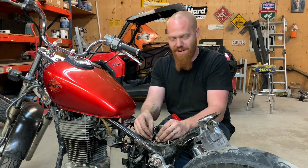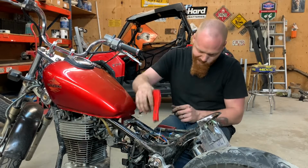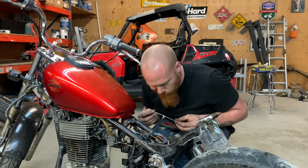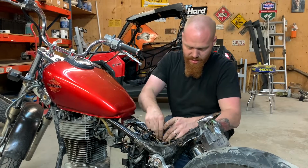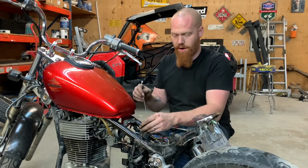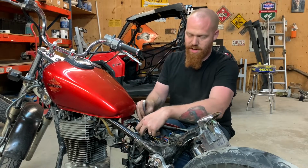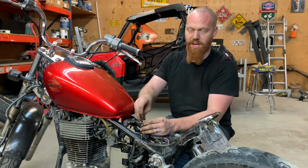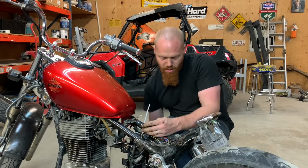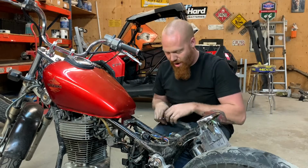And something else that I never actually mentioned in the video, which is funny that I didn't. The day we got into St. John's, we got to the campground and we were hungry and it was like 10 o'clock. So we drove into St. John's and got some poutine or whatever for supper. And on the way back to the campground at 1 o'clock in the morning, the turbo drain melted on the manifold and melted a big hole in it and buried everything in oil. Buried the whole manifold in oil, and it was smoking out. It smoked out the whole truck, and I stopped. And when I took the hood off, it just billowed smoke all over the highway.